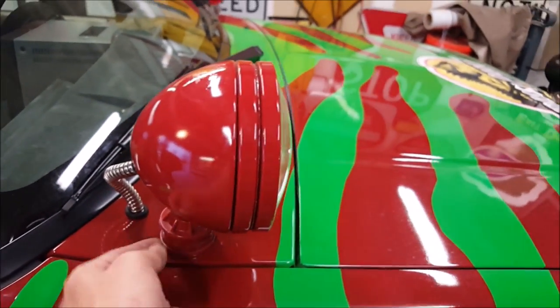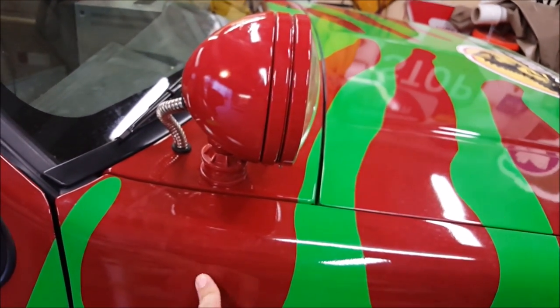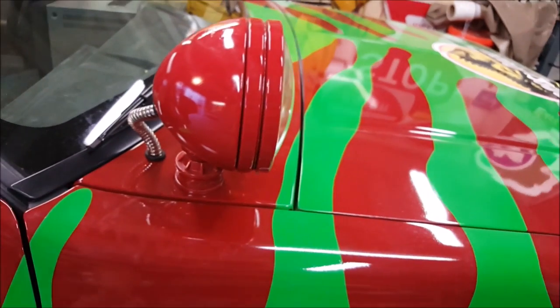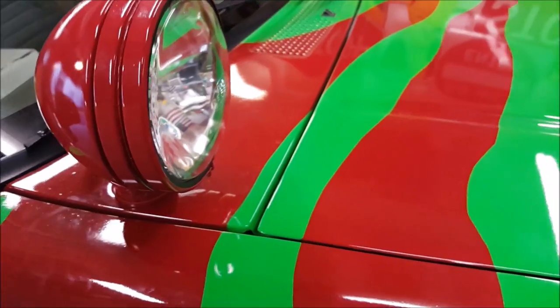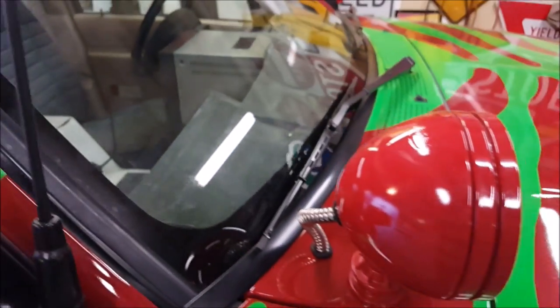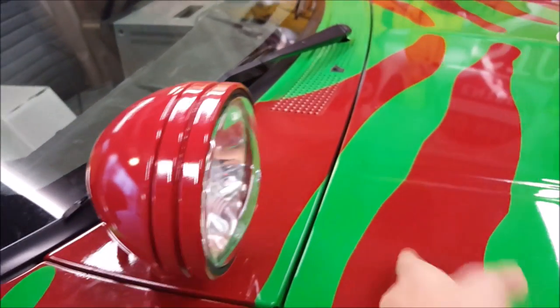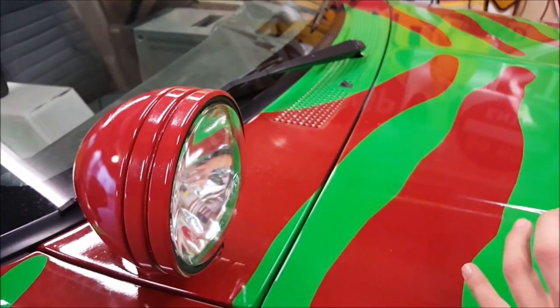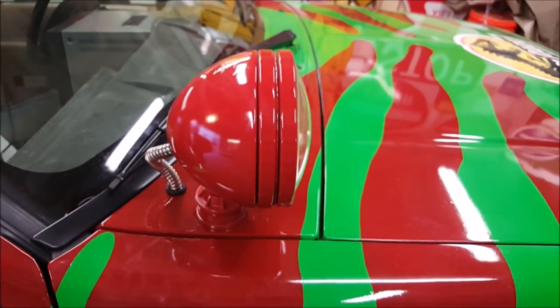Getting to the underside of this to mount it is a little tricky. You can't get to it from the fender area — I thought maybe you could take out the fender lining and get up in there, but the only way to get to it is by taking the blower motor out or cutting a little access hole in your firewall. If you take the AC blower motor out, that gives you access to the cowl area to get to the underside for mounting.